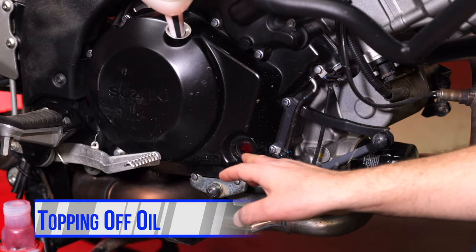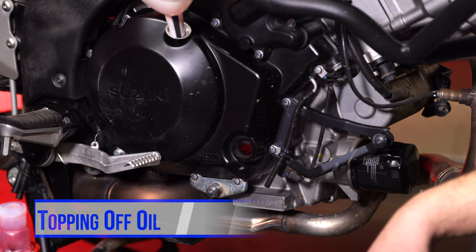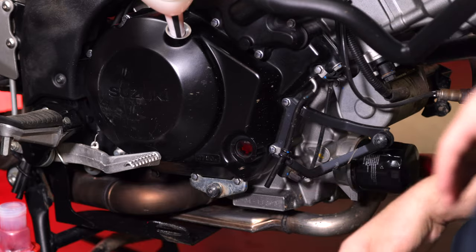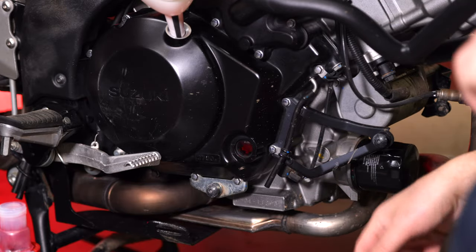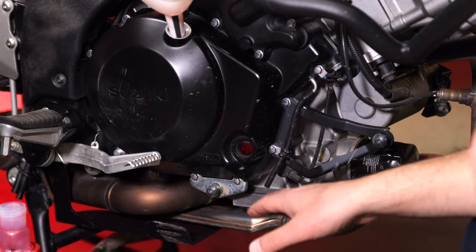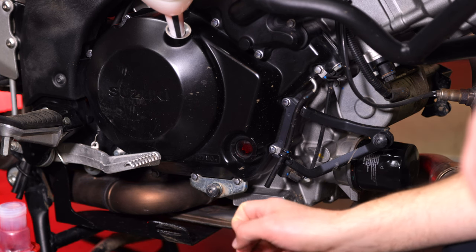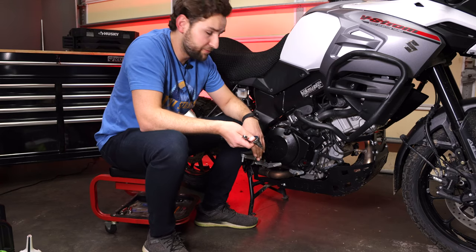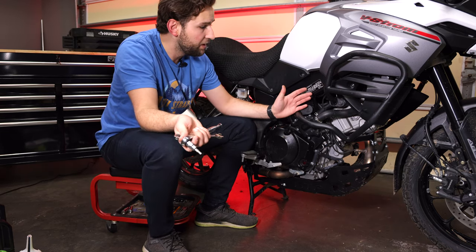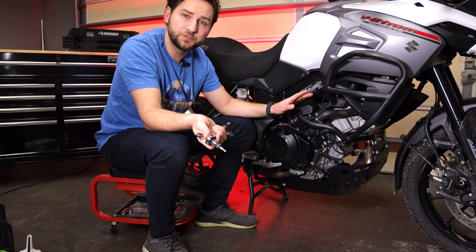At this point, as you can see, the sight glass is full, although I still have a little bit too much oil left in my canister. That is because the oil filter has not filled up with oil yet. To do that, start your bike with everything closed and safe, let the engine throw the oil around — it'll get into your filter — then let it settle and check your level at that point because it might go down a little bit. Feel free to add just a little bit of oil to top it off. That about wraps it up for the oil change on the V-Strom. Hopefully this video was helpful — if it was, feel free to subscribe and like the video. If you have any questions or requests for maintenance videos, leave those down in the comments below and we'll see you in the next video.